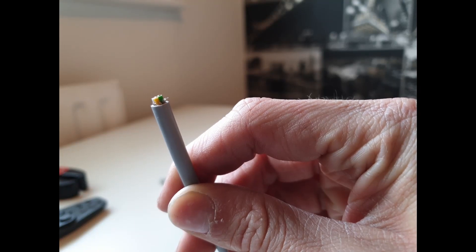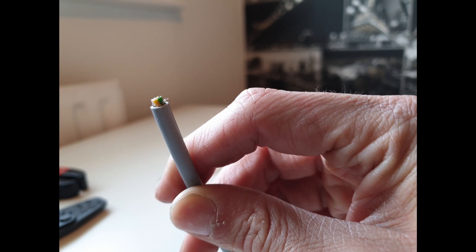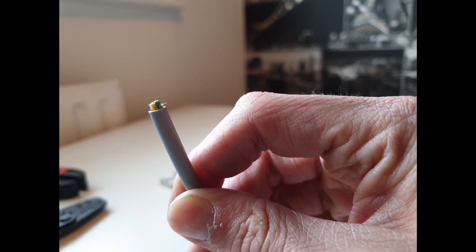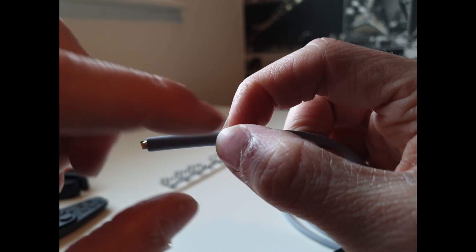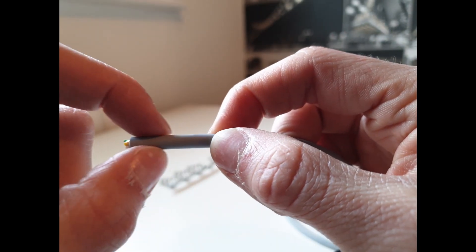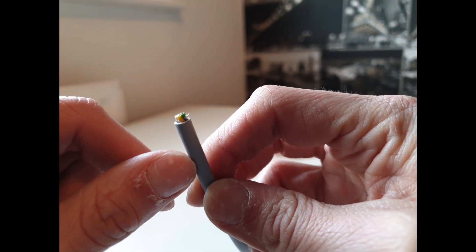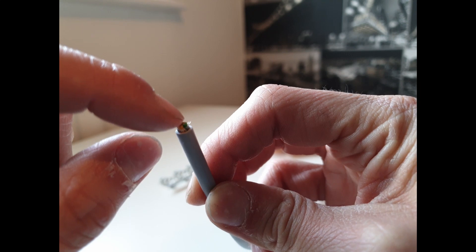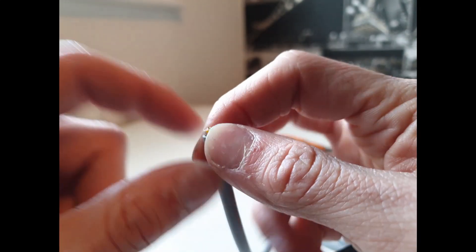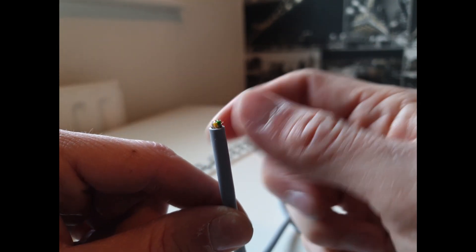So this is the end of the cable, and as you can see there are some silver wires poking out — that's the actual grounding sheath itself. What we're going to do to get to that is score the PVC and just peel it off using a razor blade. Then we're going to take the wires and tuck them through the earth sheathing.